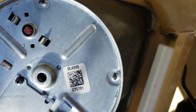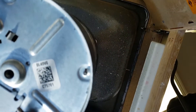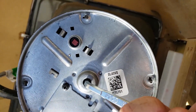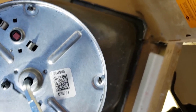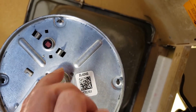This is a reset button. If you turn the garbage disposal on and nothing happens, hit this reset button first. Now, we're going to put the allen wrench in here and try to turn it. You can see it's turning a little bit, but we've still got something stuck in here because it's not turning very well.